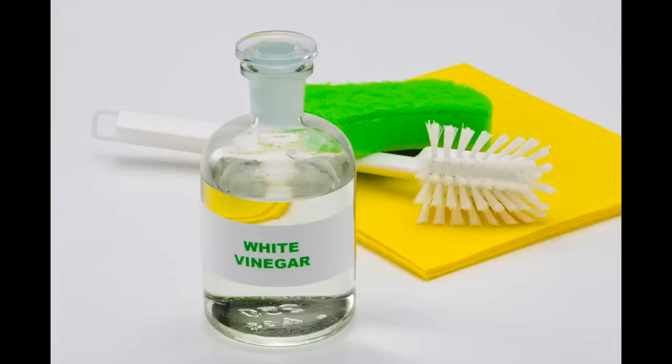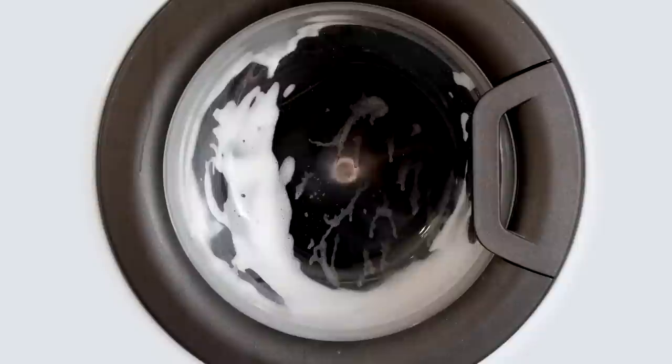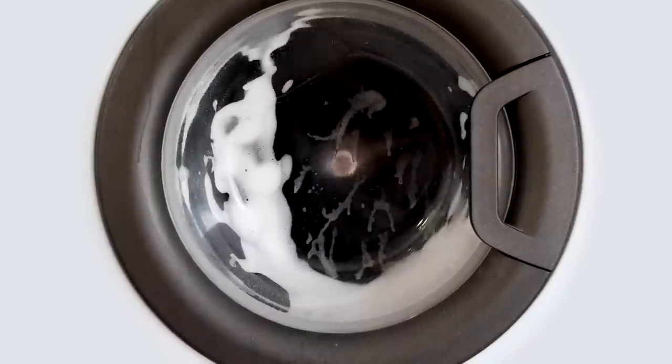Is there something you need to do to your machine to get rid of that buildup? You can give it a cup of vinegar — it doesn't suds so it's not going to cause problems. Just run an empty washer, or you can run some junk rags. The hoses and pumps in the bottom of these units get scum built up and it pinches off the hoses and starves and gums up the pumps.